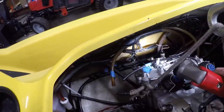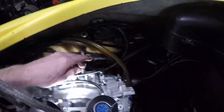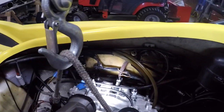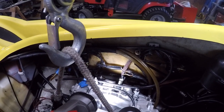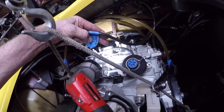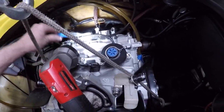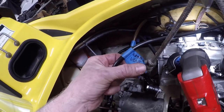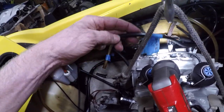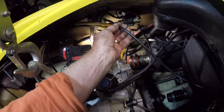And the line that goes to the vent, the counterbalance vent, is way too big in diameter. I've lost it now, it's fallen down somewhere. I gotta find it. So we have to sort that out. So I'm gonna do a little bit of research and then I'll show you what I found. What's this here? Oh, that's it right there. Crank vent. But that is way too large diameter. So something is mislabeled or mixed up. So counterbalance mystery vent solved.